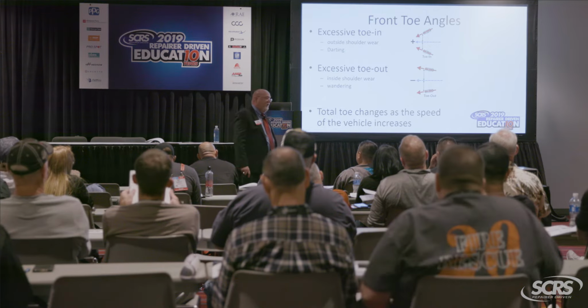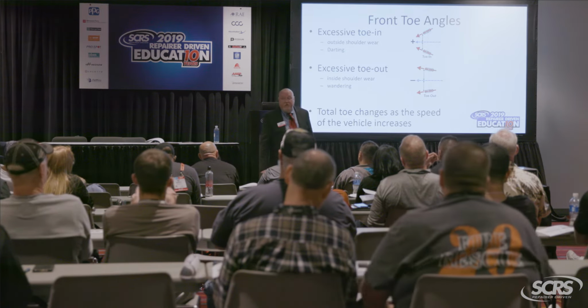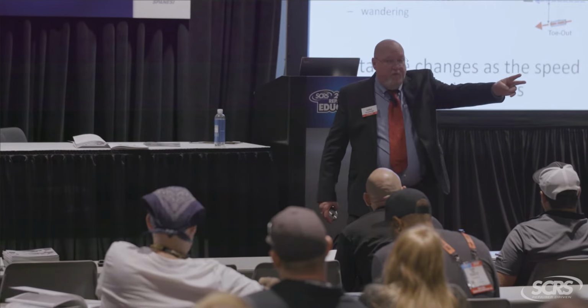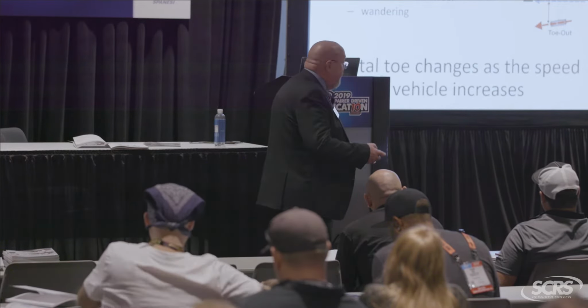And some of these ADAS systems, like night vision on an Audi A7, can see up to 600 meters up in front of that car. So if I'm off just a little bit back there, I'm looking off into the woods instead of at Bambi in the middle of the road. So it's pretty touchy, this toe business.